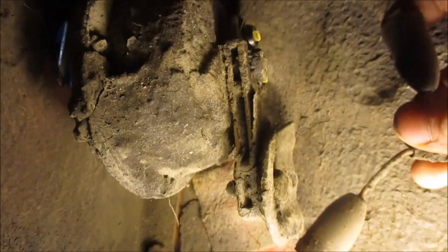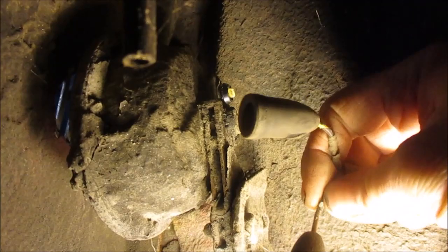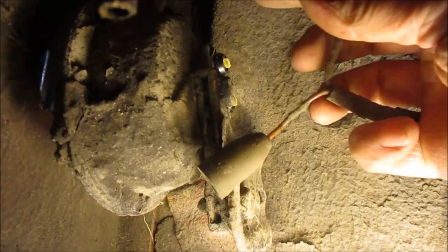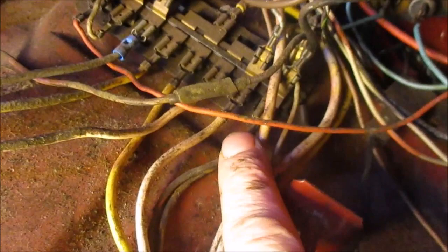We do have another horn in stock if we need it. All right, so I'll just reconnect them. For this car it was a yellow and black wire on top, and a solid brown one on the bottom. So follow those up there. I'll get them plugged back in and we'll see where we find them up top. So the yellow and black wire goes right here to this first fuse. So that's where we're gonna go inside and take a look at that first fuse.